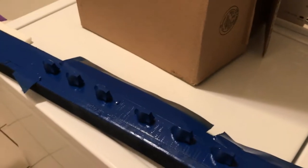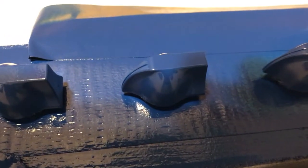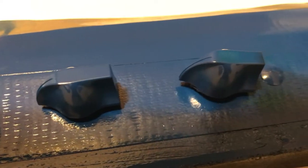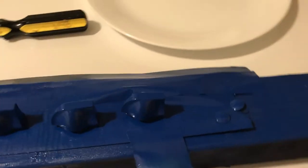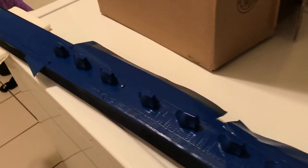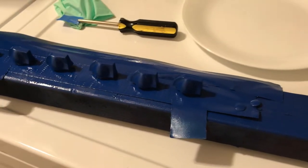I did one light coat and two final wet coats, and it came out really well. You can even see the indicator line on the knob heads — you don't want to go too heavy or you'd lose that. Make sure you're doing it in a single-row fashion; that's the most important part so you won't have overspray on your final coats. Read your directions and do it right. Post any questions below.